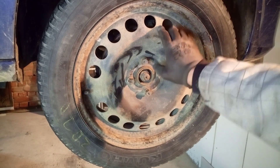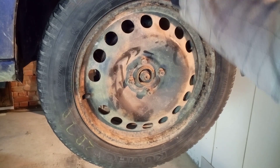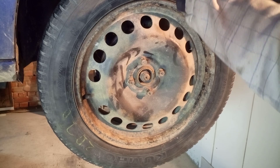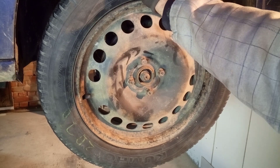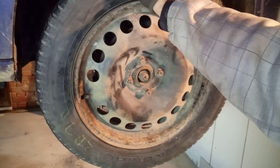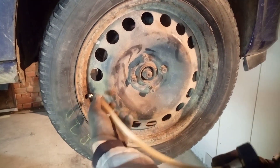After installation, always check the pressure on these tires because they were sitting for the whole summer. You want to pump the tire to about 2.3 bars. Now we are checking the pressure.